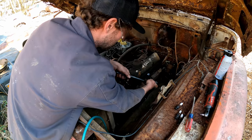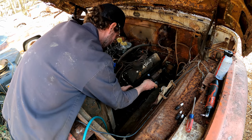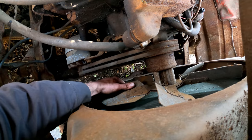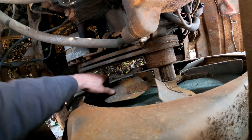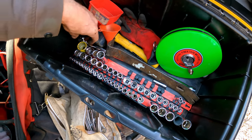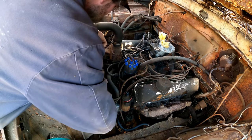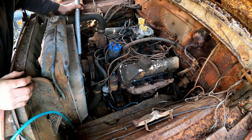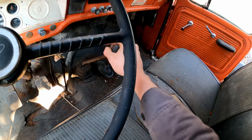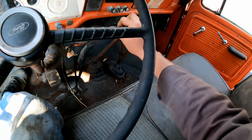Using some fogging oil. After soaking, let's grab the fan and rotate it — nope, not yet. I happen to not have the right socket size for the crank; I go from 7/8 to 27, but let's get a monkey wrench on this fan. There it goes — the motor budged a little bit. Making sure I didn't leave it in gear, which I did. And the clutch even released, although the pedal doesn't come back up unless I pull it.